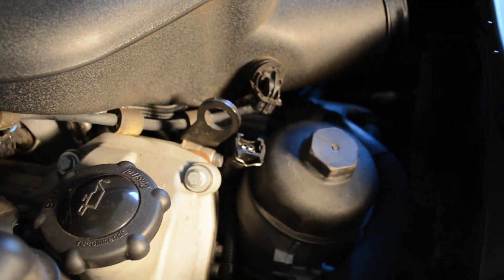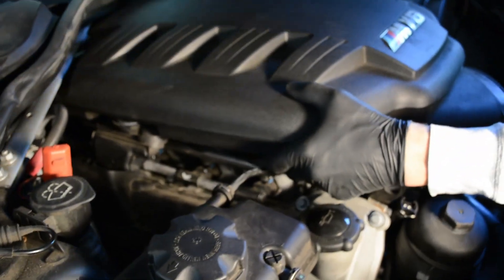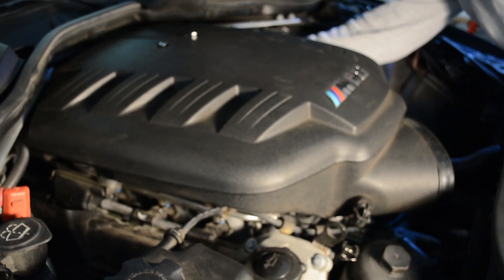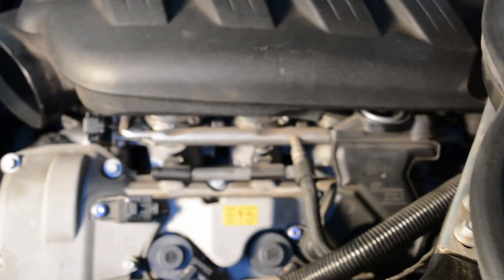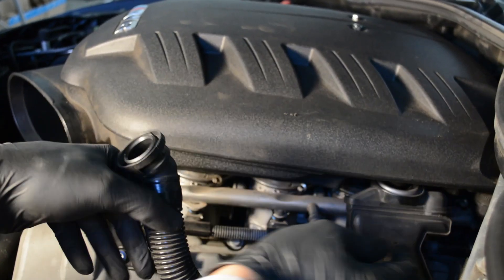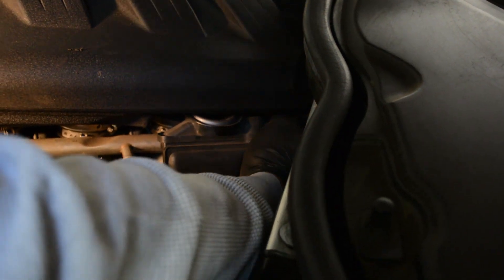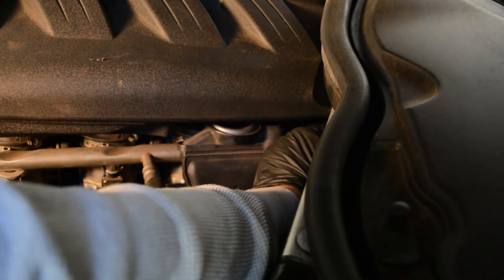Alright, now I'm going to start to pull up. Oh wow, look at that. I'm going to pull up the sides and the back and try to release them. They feel like they're ready to go. There's one, and we get already two. I think there's another one of those airlines that needs to come. So back here, there's another airline that needs to come undone — same style where you push the two plastic pieces to unclamp it. Air injection type stuff. Every throttle has its own barcode — that's interesting.